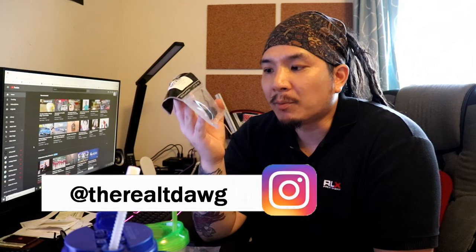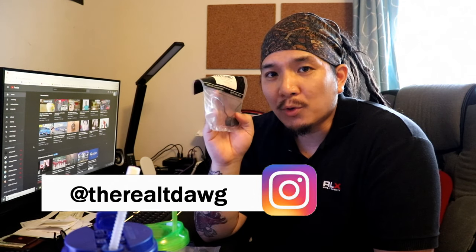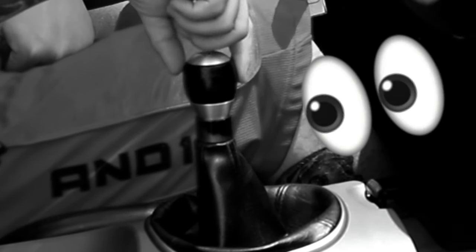Like all rubber does over time, it wears out, softens, hardens, or cracks. When they wear out, they cause a little bit of movement in the shifter. I don't know if that's really an issue with the RSX, but I'm replacing them anyway. When I get a short shifter in the future, I'll use these anyway. The k-tuned shifter pivot ball and spring replaces the OEM spring and pivot ball and is supposed to remove any slack and looseness in the shift feel. If you saw the walk-around video, you saw how much play there was - so this should hopefully eliminate all that. Let's go outside and install it.